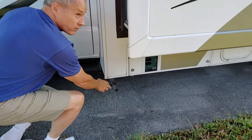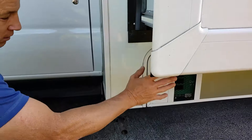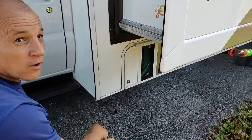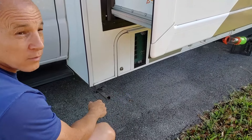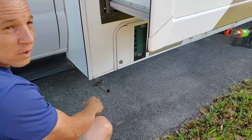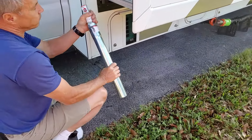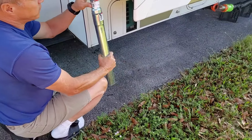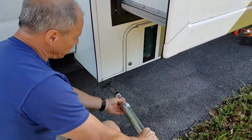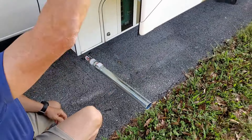This is the exhaust for the generator. While this wall is open, the exhaust is coming up into the RV — we can actually smell it when the generator is running and the wall is open. So I made this up with just a bunch of pipes from the auto parts store. We got some muffler reducers and stuff like that and made this little extension that slides on there just to keep the exhaust from coming up into the RV.